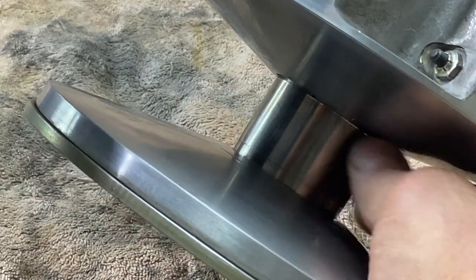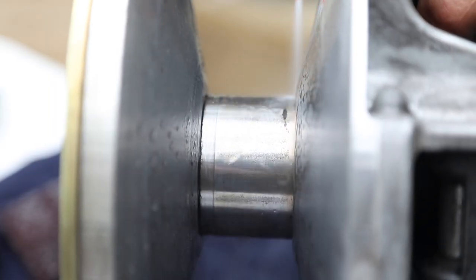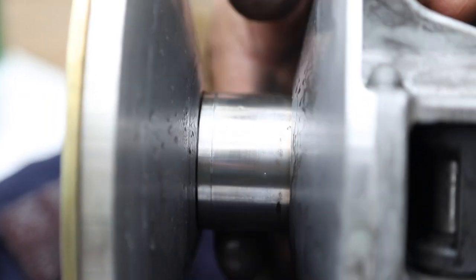So it's very important to keep this clutch nice and clean. Blow it out in there every time you can. If you take it apart, put some brake cleaner in there or something and blow it out and make sure it's nice and clean. Make sure you keep your clutches clean — blow them out as often as you can and they will last a lot longer. Thanks for tuning in. Please subscribe to our channel, turn on that bell notification, and we'll be sending you some new videos soon. Ciao.